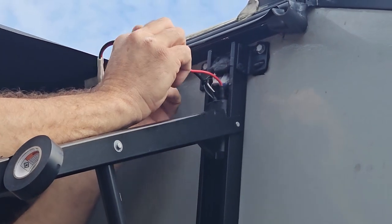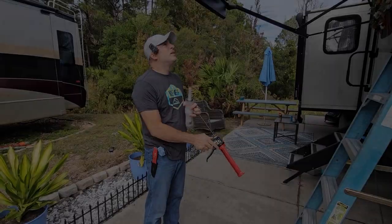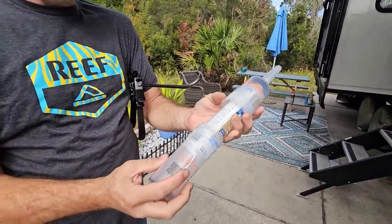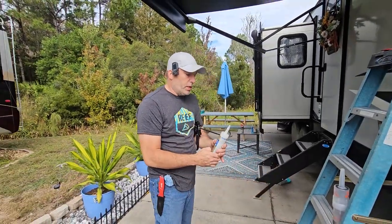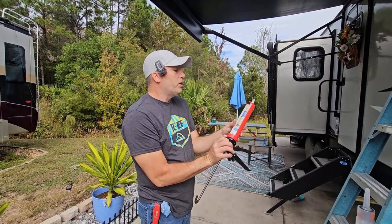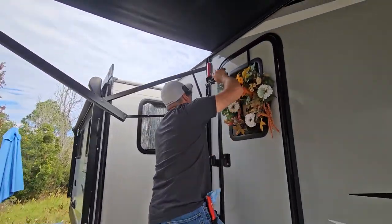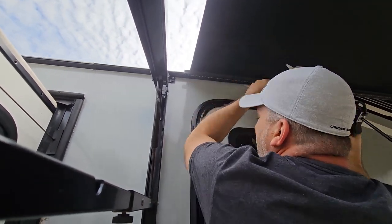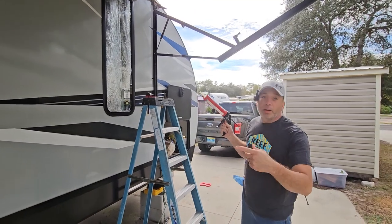We're finishing up and tightening the wires. We plugged in our connector — you can hear the audible click when it seats. The rubber boot is sealed. We feed the excess wires in to make it look neater. Now we seal up both ends with clear GE silicone. If you haven't seen these airtight caps for silicone tubes, they're great — keeps the silicone from drying out. Just put a dab in each end to lock the strip in place so it doesn't work itself out while traveling. Make sure you clean out any lube from the ends first before applying silicone.